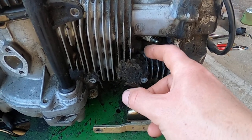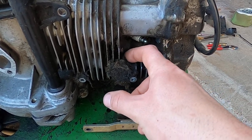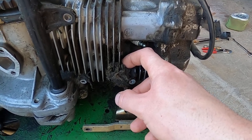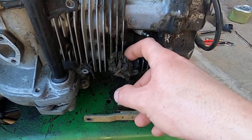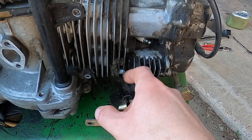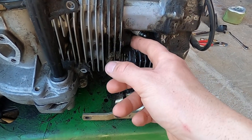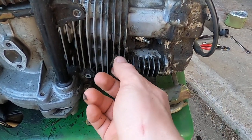But this is an issue. So every few years you've got to take these apart. You can see that gunk is just folding out of there — all those cooling fins were clogged, which means it's going to cause it to overheat.